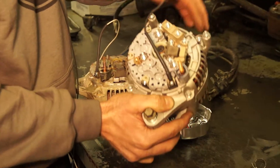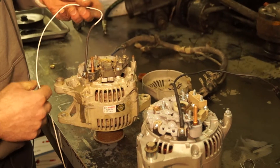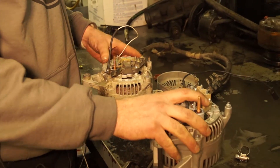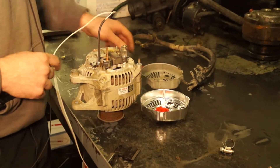So here is another one. This one's a little bit cleaner — it's got the tach wire. Ours is going to be going into a GM product and they use a white wire for the tachometer, so we decided to go with the white wire.